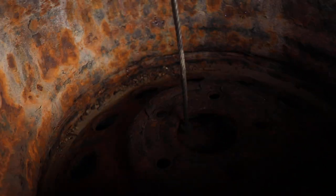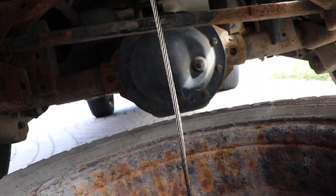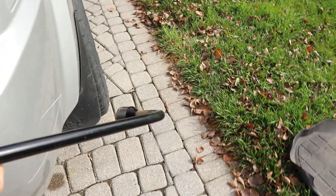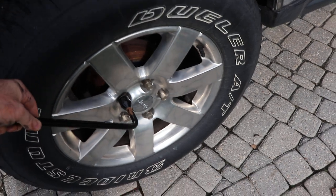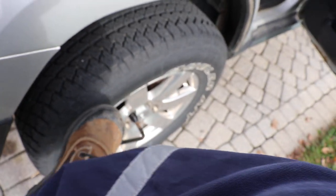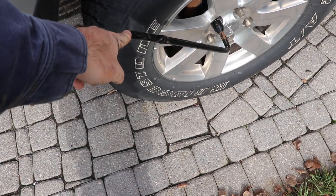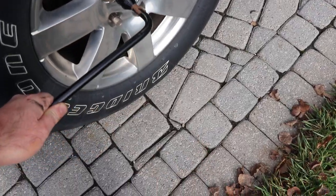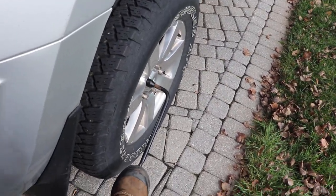In my case I don't actually want to get the tire out — I'm trying to do a job changing a filler neck — but that's the deal with this. If you're having trouble getting the lug nuts loose, you can put the tool on and just stand up on it, kind of bounce, and hopefully get them loosened off. If you don't have a lot of upper body strength, just be careful not to stab yourself with the end of the tool.